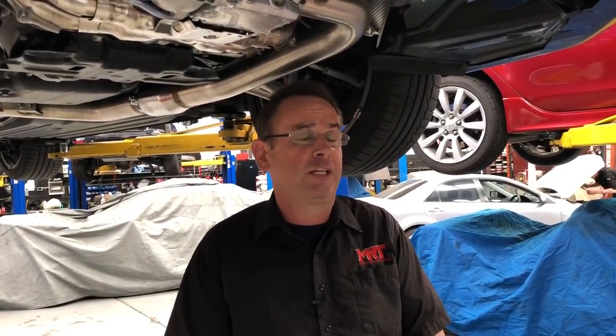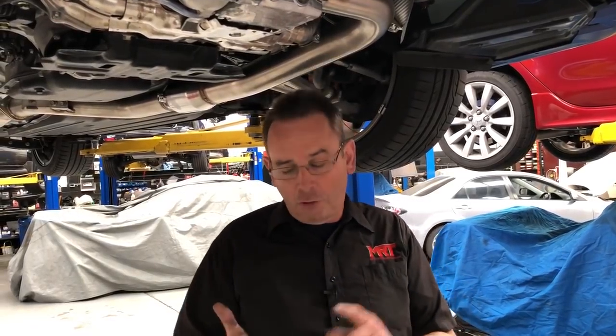People also ask about exhaust manifolds. We're talking about a twin scroll turbo, and I'm yet to see a bolt-on exhaust manifold on the two litre direct injection engine that will give a reliable increase in performance for the cost. The same goes for riser manifolds or TGV deletes — we've tested those, they're okay to be replaced, but they don't add any net increase in power if you're getting a good, reliable tune from a tuner with good proven experience.